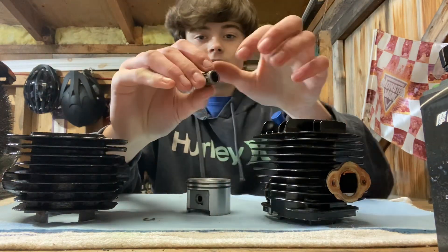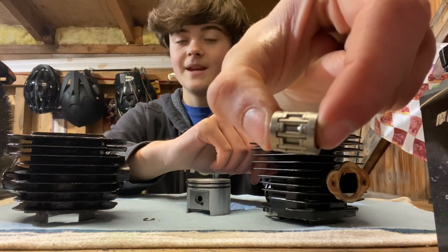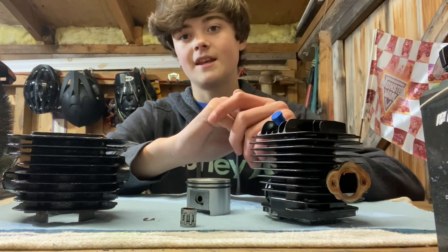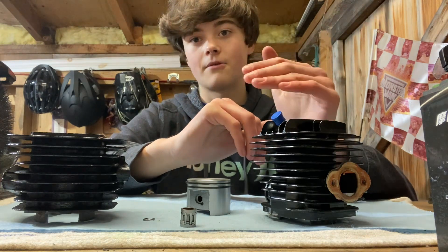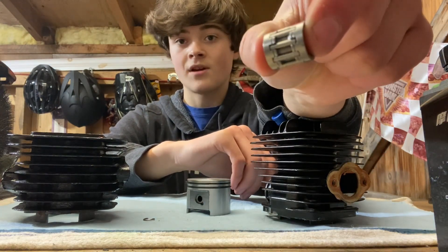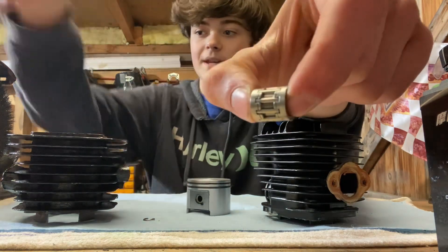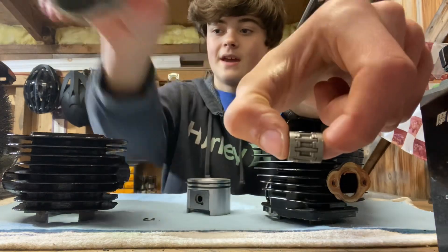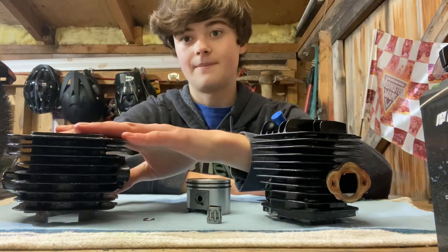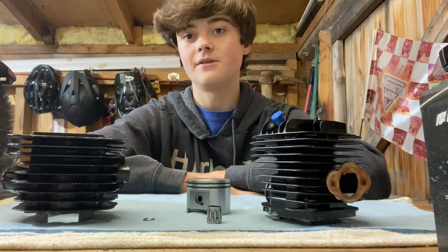Here's another thing — this is a really good style of wrist pin bearing and I like these a lot better. You may notice that a lot of these newer engines, like the G4s and some of the new YDs, have a ticking sound. This is either the lower conrod bearing itself or the wrist pin. This is a moped-style bearing — if you can upgrade to this, go for it. It's wider, so it gives the piston more support on the wrist pin, and it has a tighter tolerance and better quality. This one originally came in my Harley Davidson motor and it never ticked. But a lot of newer motors come with cheaper wrist pin bearings and have a lot more noise.